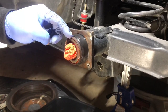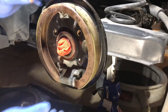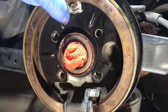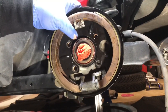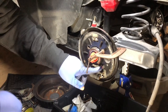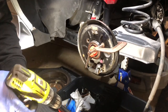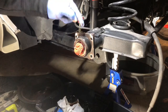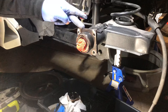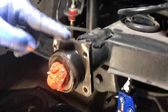What I did was, since the hub is smaller than the inside of the bracket, I ran some electrical tape to take out all the slop so it'll be perfectly centered - all the way around and around until I got it to fit snug. It looks like I'll be able to catch one hole here perfectly, this one's a little bit off, and these two will have to be brand new. I got the first hole drilled, put the bolt in tight, then center-drilled it with the larger bit and finished drilling the remaining holes. Once all four holes are drilled, I removed the electrical tape and put some Rust-Oleum on to make it look a little bit better. I also had to grind back the corners a little bit to make it fit properly in the backing plate.